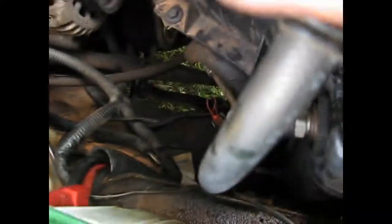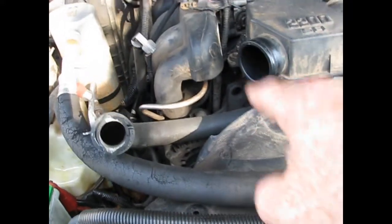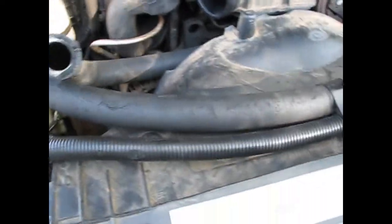So now I've got to buy a radiator. Something else we find: this high-pressure air conditioning line has got a hole in it right there, and every time you move it just a little bit it squirts out even more freon. So we need these two air conditioning hoses and a new radiator, and we still haven't gotten in here to figure out whether it's the alternator or an idler pulley that's got a bad bearing in it. So we go deeper.